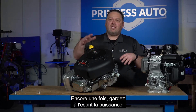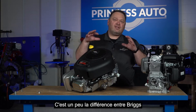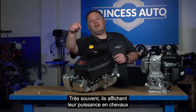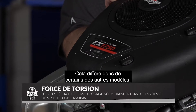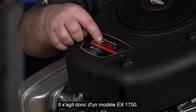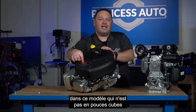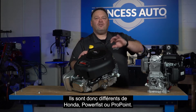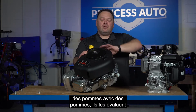A key difference between Briggs and other engine manufacturers is how they rate power. Briggs quite often puts their horsepower — and sometimes torque ratings — right on the engine. This model here has a 17.5 gross horsepower, model EX1750. They incorporate that horsepower within the model name. That is not cubic inches or cubic centimeters; it is their line of horsepower-rated products. So they do differ from Honda, PowerFist, or Pro Point — just keep that in mind when comparing apples to apples.